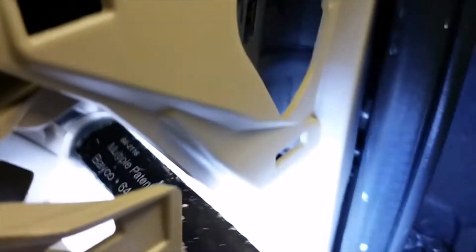I'm hitting that. In between those two little rails is a metal clip you got to release. When you release that, and then you do the same right down in here. Yeah, right down in between those two little rails. Let me see, inside there, right in there. This side will drop out. That's how you release it. If I had more light, I could point a little bit better here.